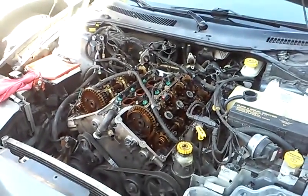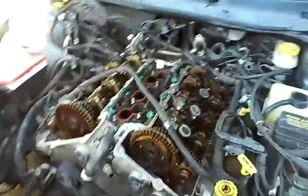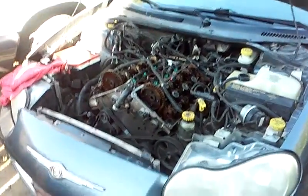Today we are going to start removing the front half of this engine — the two tensioners and the crankshaft. Part of the job today will be setting the engine to top dead center. If we don't set this engine correctly, when we try to put it back together and start it, it will completely eat itself up, and I'll end up having to buy these people a new engine. From this point on, it is time to slow down so we can speed up later.